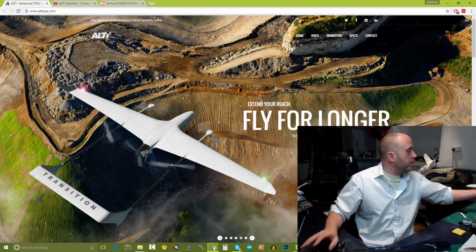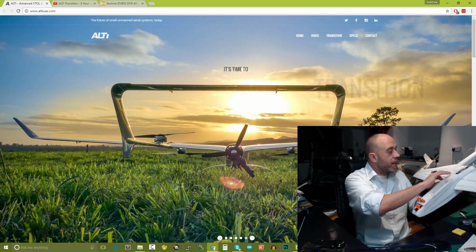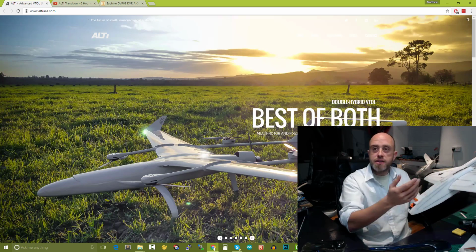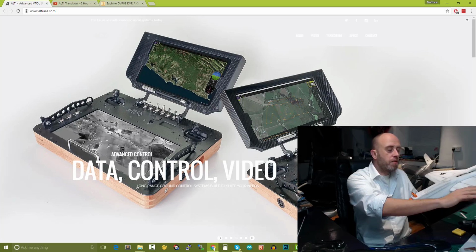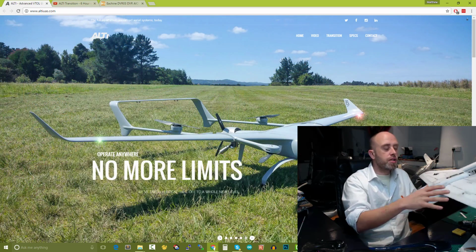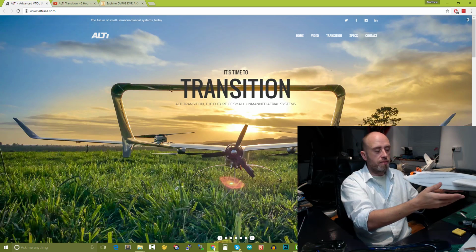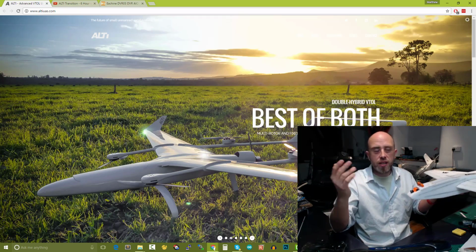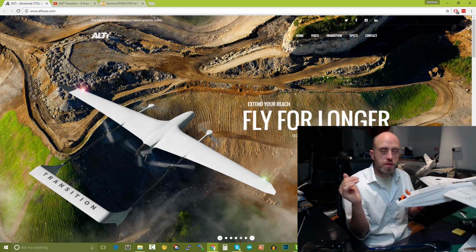But I can tell you, building it has been quite a good challenge. Each component has required quite a bit of planning and prior thought, and the one piece which has helped me the most with this model is pinning the model up to work out where the CG was going to be, what the layout of the components was going to be. Now I am keeping the video transmitter on the top of the wing, and yes, I could have mounted the servos underneath, as it would have looked more visually attractive, and the same for the FPV transmitter. But in reality this has very, very low ground clearance underneath the wing, so it's better that we have the servos top mounted here. And the video transmitter makes a lot of heat, so we need to get heat to rise. If we put it underneath here, it would be in its own little warm cozy coat, and would end up burning out. So I always put mine on the top for maximum airflow.